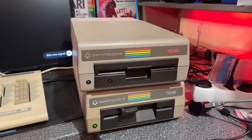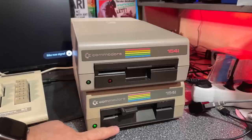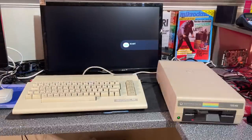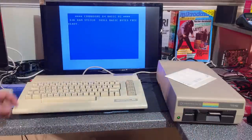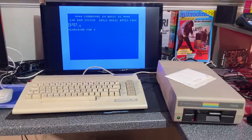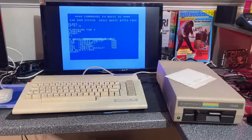If the red LED turns on and then off, it has initialized correctly — which it did, so that's a good sign. There were probably several revisions of these floppy disk drives. You can see the color difference: this one has a rectangular red LED and this one is round. Then I turned on the machine and the drive initialized again, so let's test with this random floppy disk.